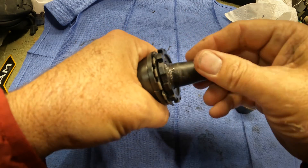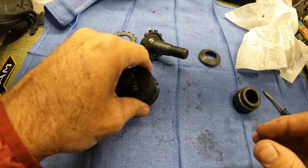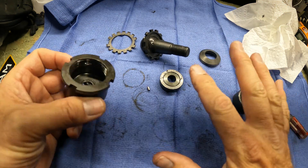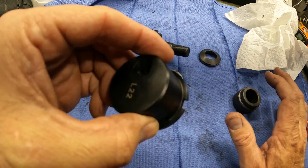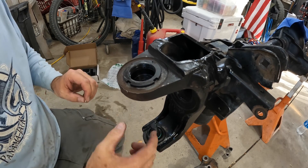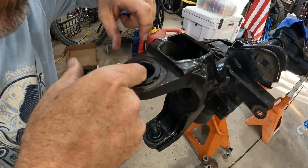What I ended up doing was disassembling it and then tapping this out — that finally worked after about 30 minutes. So I just disassembled it, got all the parts out including the little pin, and kept track of everything in a clean work area. Then I pressed the body in by itself and went ahead and assembled all the parts. Now we've got the ball joints pressed in — I just flipped it over 180 degrees so we can work from the bottom of the axle. Makes it so much easier than getting underneath it.